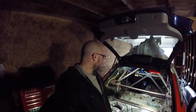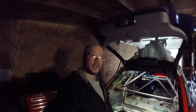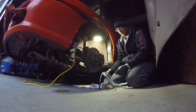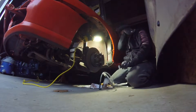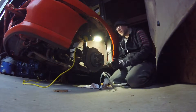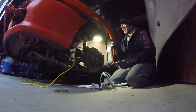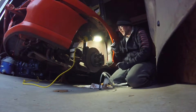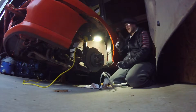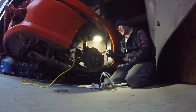I'm going to leave the system right now and check for leaks. Bleeding the brakes has been a little trickier than I was expecting. Three out of the four bleeder screws are actually rusted, so I've been bleeding each corner with one good bleeder screw, swapping it as I go around, and I'm on the last corner.